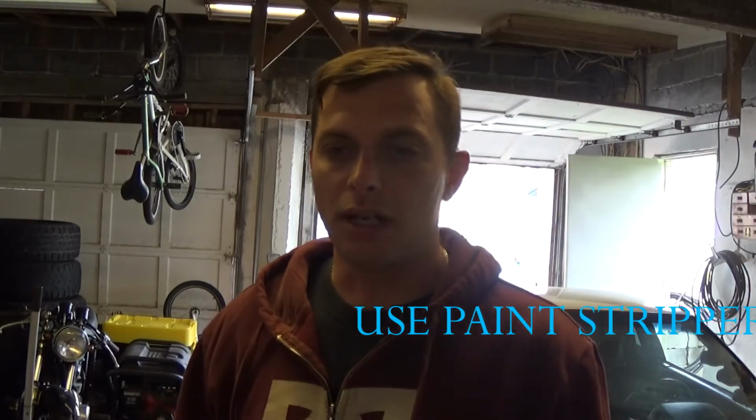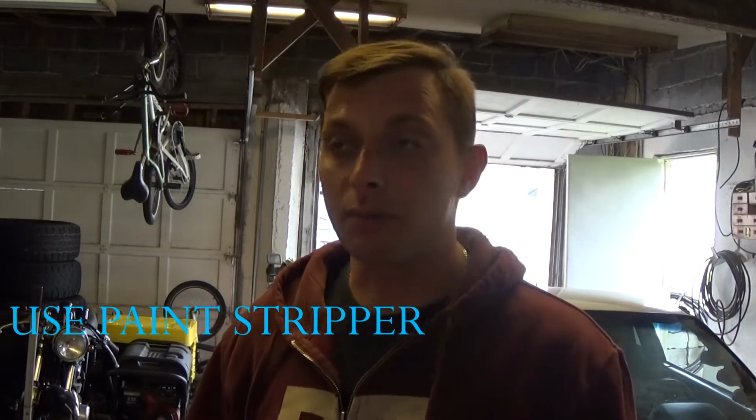If you haven't ever properly sanded down your valve cover before, you have to basically sand it all down with various grits of sandpaper. I would start with like a 180, then bump it up to 220, then 320, then coat it with some high temp primer, then paint it whatever color you would like.